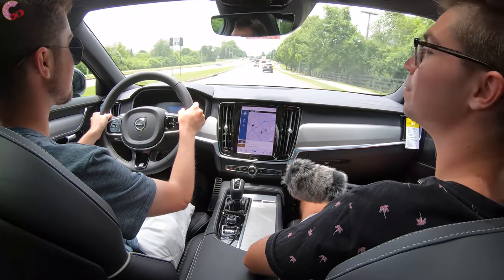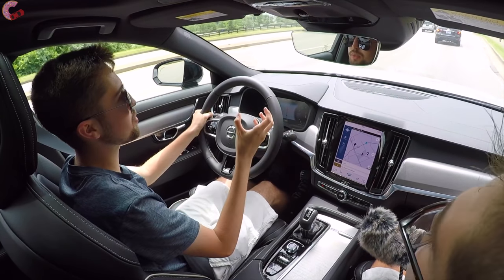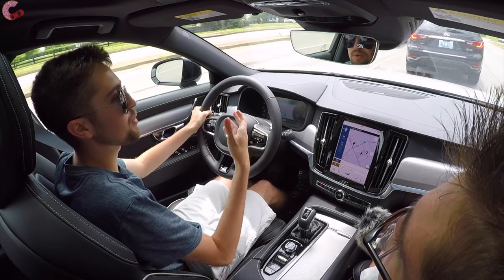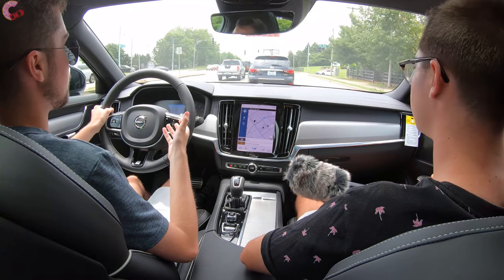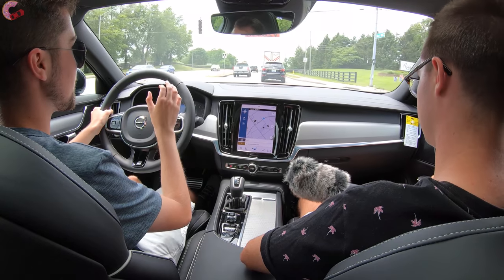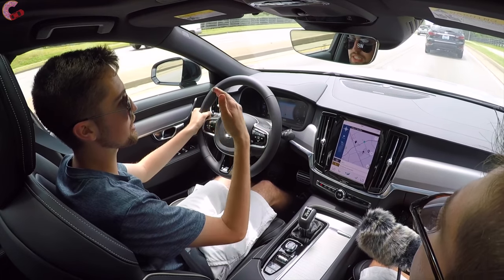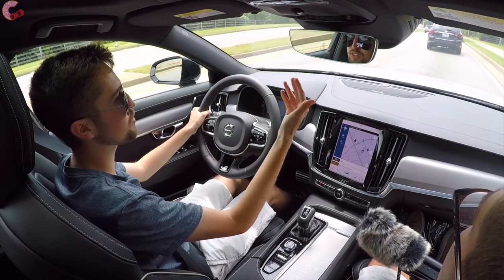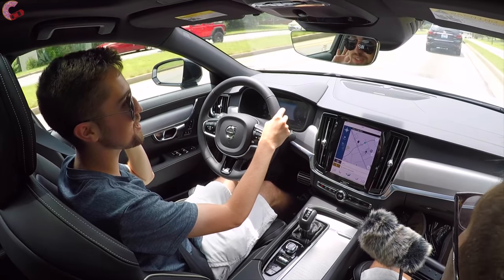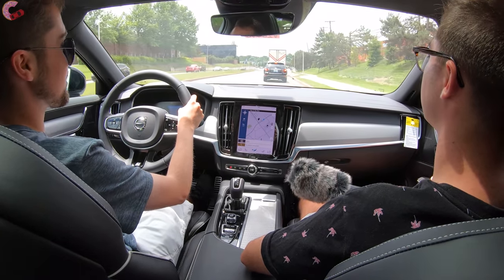It really scoots — I'm really impressed. Another thing I like is it doesn't really sound like a four-cylinder. Part of the appeal of having a six-cylinder is something smooth and refined, quiet, doesn't sound strained — and I really don't feel that in this four-cylinder at all. You can actually hear the supercharger at low RPMs. How this system works is basically the supercharger acts on the low end and then hands off to the turbocharger at upper RPMs because that's more efficient. You can actually hear a little supercharger whine in this luxury limo type of car — that's a really cool characteristic.